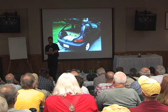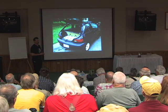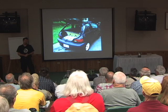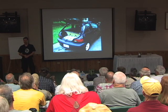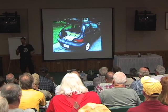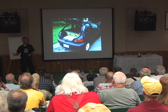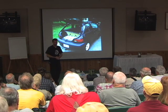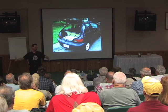These are deep cycle sealed lead-acid batteries, sealed as opposed to flooded batteries. Flooded batteries are what are used for golf carts most of the time — that's the style where there's a cap you can pop off and you have to add water every once in a while, which are great batteries. More than anything, these batteries were available and cheap. Since they're sealed, it opens up other possibilities — you can mount sealed batteries sideways, for example. Generally they cost more, but in this case they were substantially less expensive.